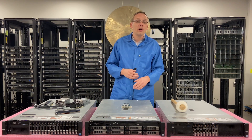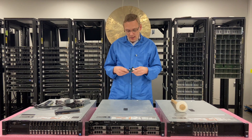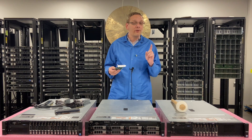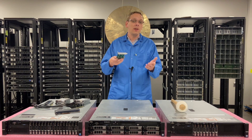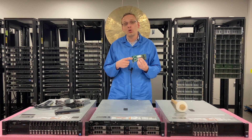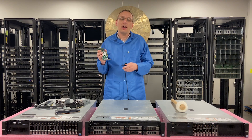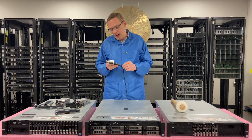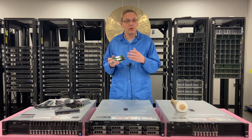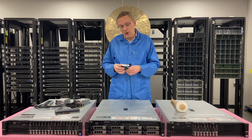So really the winner here for the R730 are the M.2s. The M.2s are the one solution that has actual possibilities where you can put an OS onto it and do some extra things, but there are some keys. You can't use the 14th gen Dell Boss card — you'd think it would be backwards compatible with the 13th gen, but it does not work. We had to use a Super Micro card, and that's actually how you can get it to work. With the M.2 and the Super Micro card, you can use them as a virtual machine or as a datastore, and you can install an OS onto each NVMe.